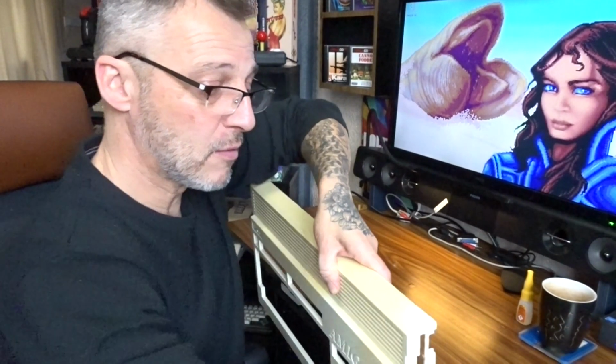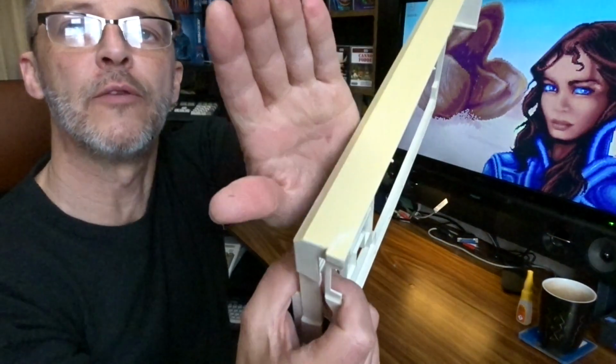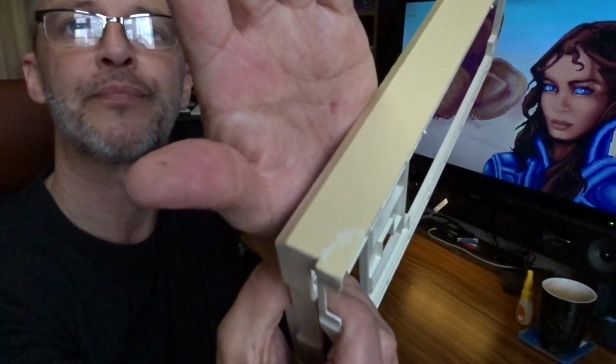So we fill that, just spin come up a bit. And then it ends up like that. You see? A couple of minutes later when that sets, I can sand all that down. You won't see the crack at all. Because it's glue, we squeezed it into the crack, and what the baking powder does is set the glue really quick. Stupidly quick, but extremely hard, a lot harder than just glue by itself.